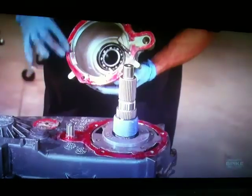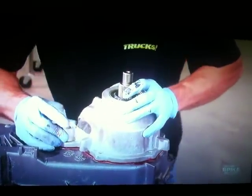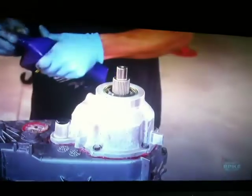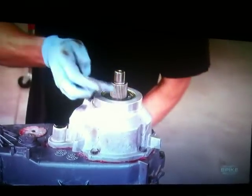We use one-inch masking tape as a guide. Then the job gets finished up by installing the new tail housing. Don't forget to put a little bit of lubrication on the output yoke seal — that will prevent possible damage to the seal during first start-up.